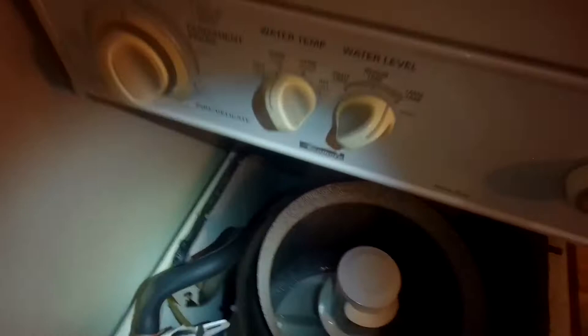I'm going to push down on the balance ring and disconnect the connectors — I think there are about eight of them all the way around the perimeter. I'll push down and pull them away to disconnect, then lift the balance ring off so I can look in there and see if there's an article of clothing or a small towel caught. That would create so much friction that during high-speed spin the motor would overheat and shut itself off. I'm looking in the perimeter between the metal spin basket and the plastic tub all the way around. I can't see anything. When you turn the spin basket you may hear a rubbing sound — I didn't hear any. I just want to look in there and rule that out.